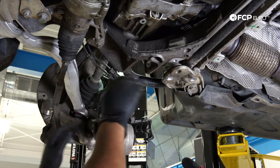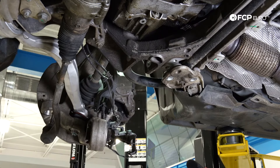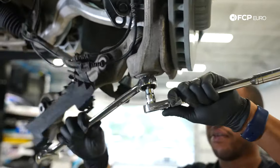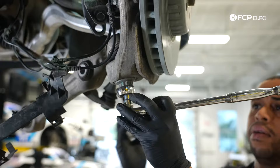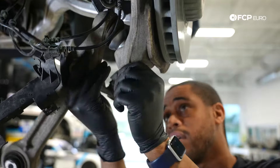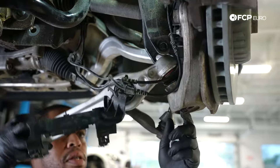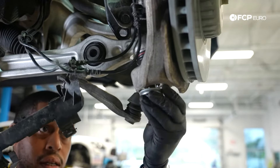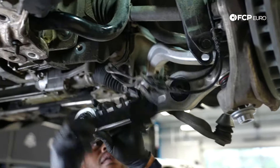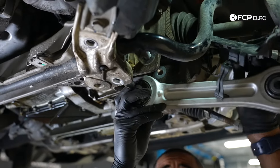So that's the bracket I was referring to — didn't take it all the way out, just loosened things up. Now we're going to remove that nut using a 24mm 12-point on the nut, counter holding with a T45. And that's out of there. Just going to slip the arm back in, tack this nut in so it doesn't go anywhere, then we'll work on getting this attached to the body. Just using this pry bar to get everything lined up properly. We've got our washer and our nut — clean side is going to face the cross member, dirty side is going to face the nut.